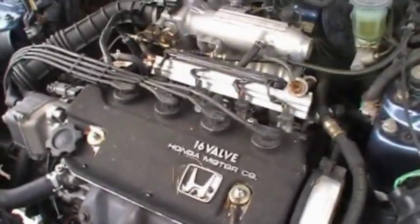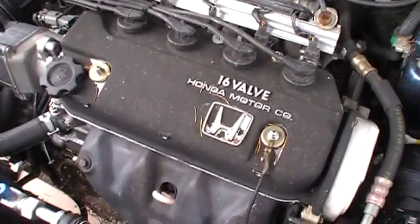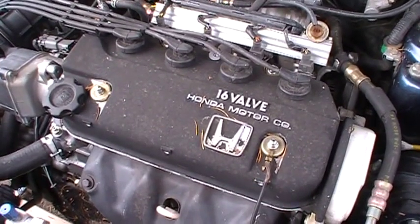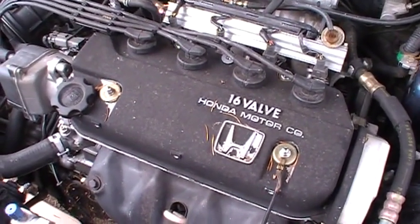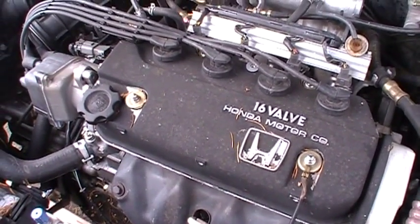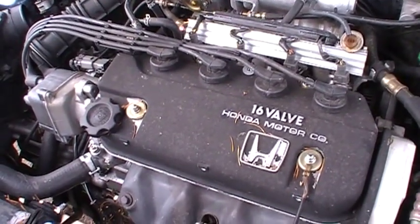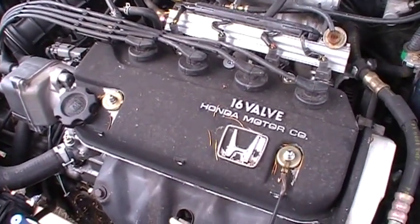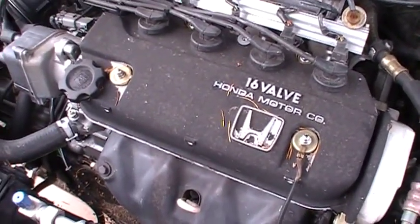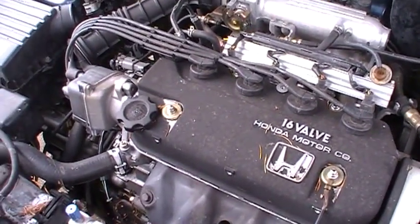Unfortunately my battery's dead, so I gotta jump it up, but I know it's going to work. So that's pretty much all you gotta do. It's kind of like an oil change, except it's actually a little bit easier. You don't have to change a filter. You could probably do it on the ground if you just turn your wheels and get to that drain plug, as long as somebody didn't reef it on really tight. And then you just pour your oil through the dipstick. This is for automatic, so manual is going to be different. If you have any questions, feel free to leave a comment below.